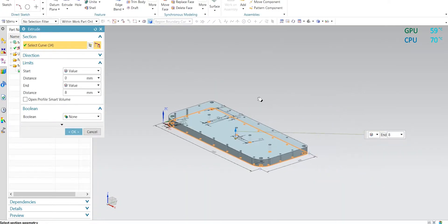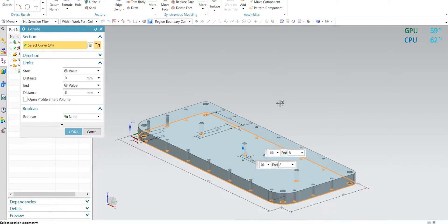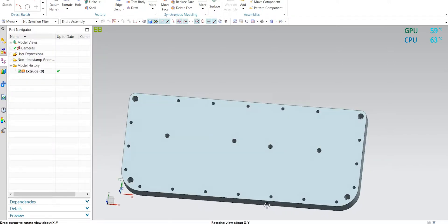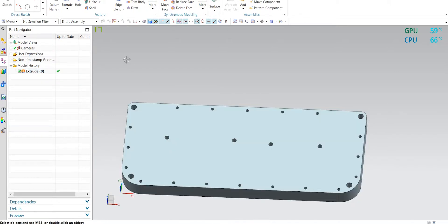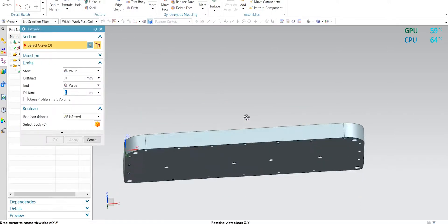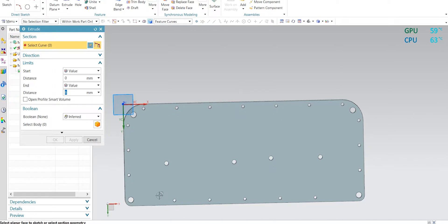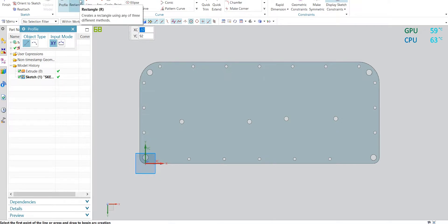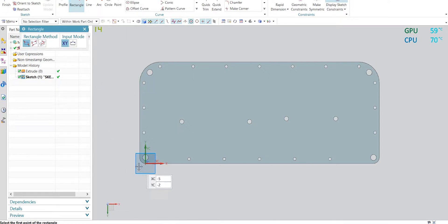The thickness of the water block will be 4mm. This could probably be smaller, but there are a couple of reasons I decided not to go thinner. Number one: I'm unsure about the pressure of the liquid inside the water block. If the pressure is high enough and the base is too thin, a crack could develop, and since the base sits right above the motherboard, any leak caused by a crack would be catastrophic. Reason number two: heat can spread not only perpendicular to the base but also along it, enhancing the cooling potential. If the base is too thin — sub 1mm thicknesses — the heat won't have enough material to spread, limiting performance.